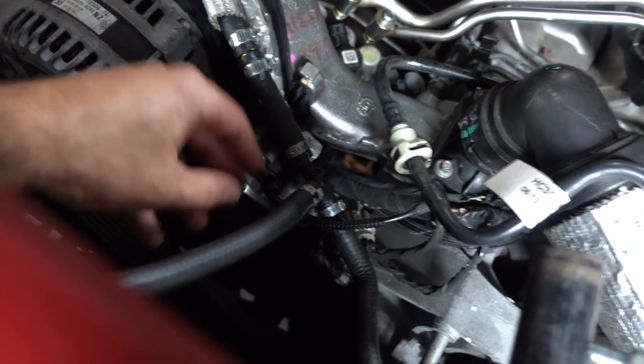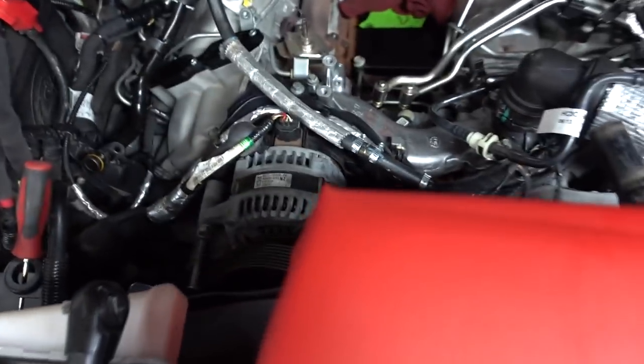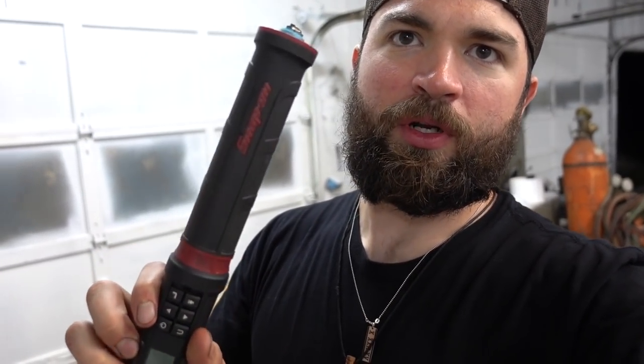The main nut for the CP4 is tight but not fully torqued yet, and the three mounting bolts for the CP4 - I found online they go to 18 foot pounds. Using the old Craftsman torque wrench, going real easy and slow. I snugged them all first and then went around for the final torque. Got two out of three torqued properly and on the third one I'm turning and turning and it's not getting tight - oh no.